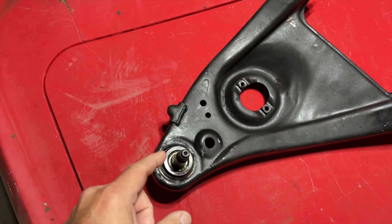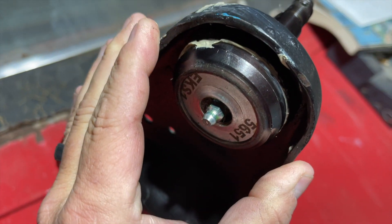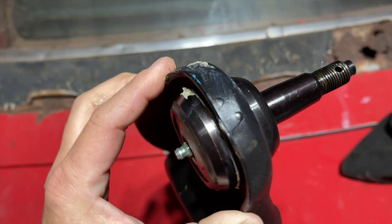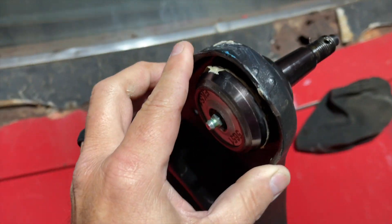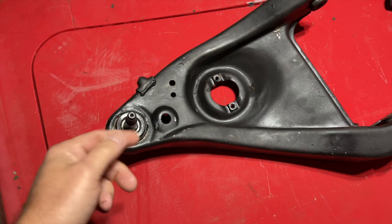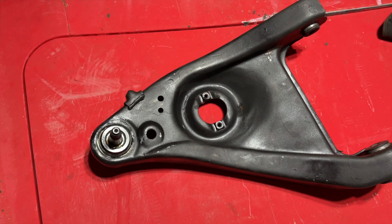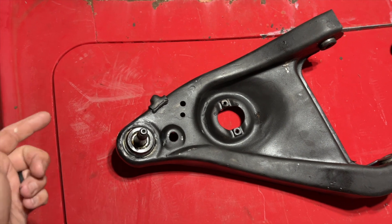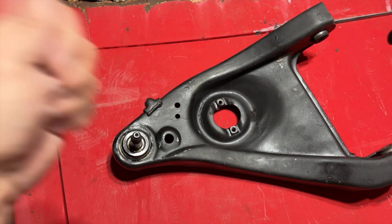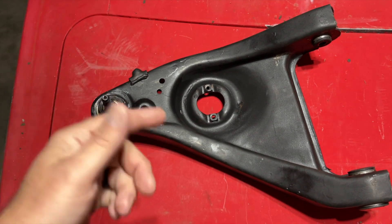One part of the video I did not show you on those lower control arms was when I installed the ball joint — and that's because I didn't install the ball joint. I could not get this son of a gun in with my tool kit for pressing these in, so I had to take them to a local machine shop. Everything else I did myself, but I had to have the ball joints put in for me. It cost me $25 a piece, so $50. If you know of a better way to put these in — I tried for a couple hours, even tried beating them in with a hammer — no good. Machine shop, $50 later, and we have A-arms ready to install.